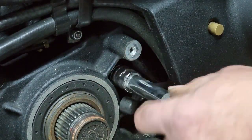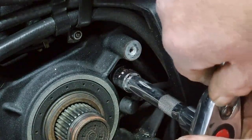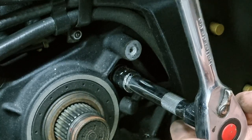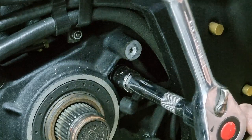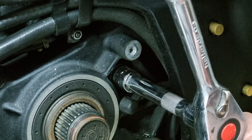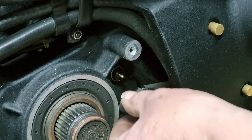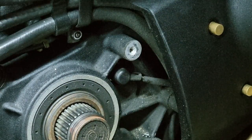There probably is a torque setting in the Harley-Davidson manual for this, but as a golden rule I'm using a half-inch ratchet here. The way I always do it: grip the bottom of the ratchet so you can't do it any more when it's hand-tight, and then just a little nip — a quarter turn forward — and that folks is enough, that's all you need. Now reconnect the wire connector.